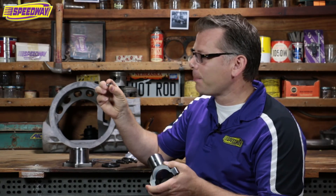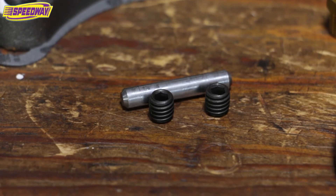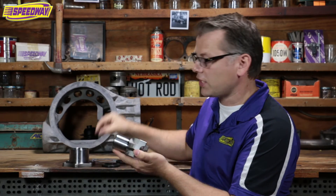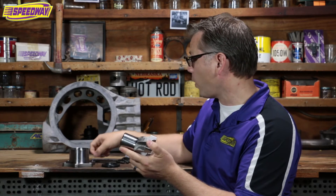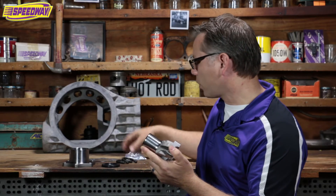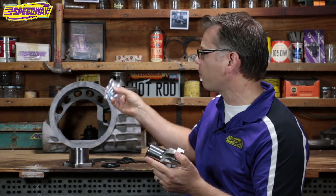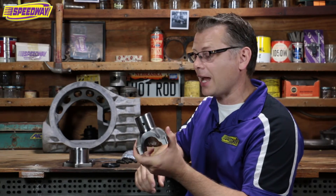This new version uses a tapered pin, which is pretty slick. You put your yoke on and drive this through to connect it to your rear end, and then it has two little set screws that finish the job — they tighten down and keep that pin from going anywhere. This is an all-inclusive kit: it comes with the gasket and all the bolts you need — a nice bolt with a lock washer. You can also use your original Ford bolts, and the nice thing about those is they still have the hole drilled for safety wire, so you can run safety wire through them, which is kind of cool.